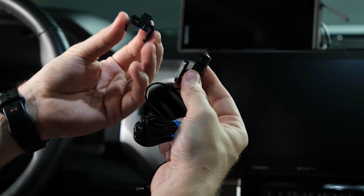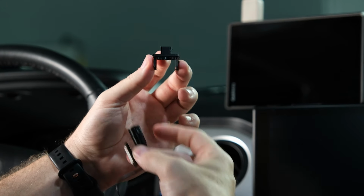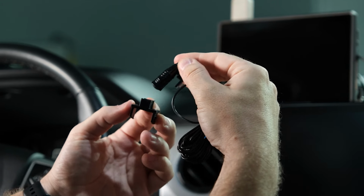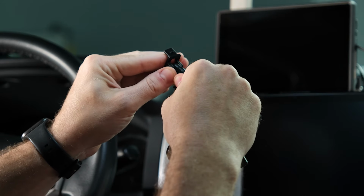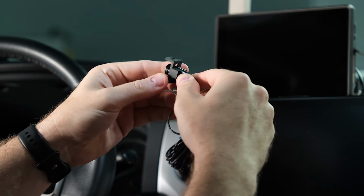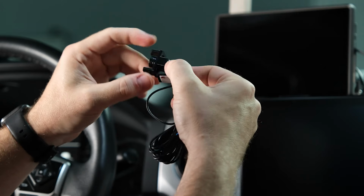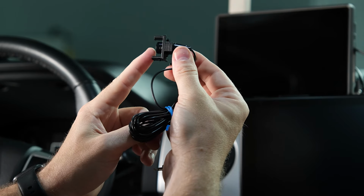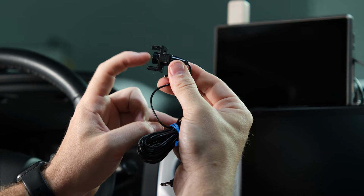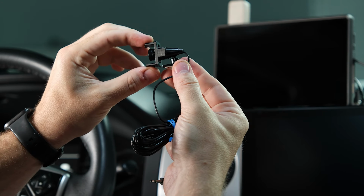And then the last assembly step is we're going to take the microphone mount. You see there's 2 legs here, and then there's 2 upper supports. The microphone with the rounded end here, we're going to stick it down into the microphone mount. So if you just go in from the top like that, just kind of keep working it in, and you'll see that the grooves in the microphone mount will line up with the grooves in the microphone, and the end of the microphone is just short of the bottom of the legs. Obviously we don't want it all the way down because otherwise this is going to be touching our headliner console. So that is all the assembly that we need for right now.